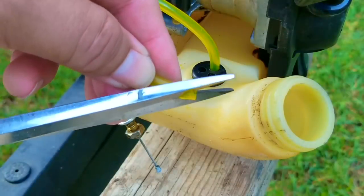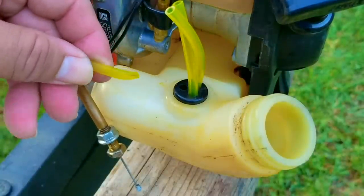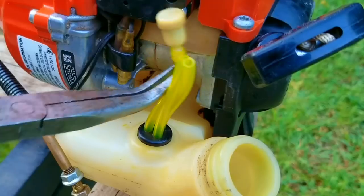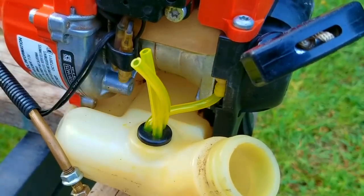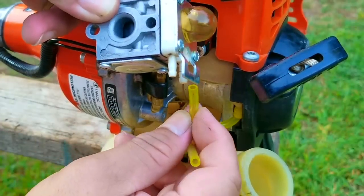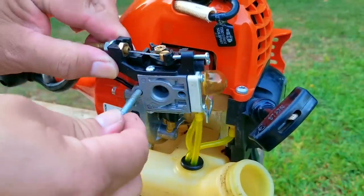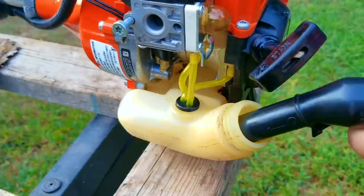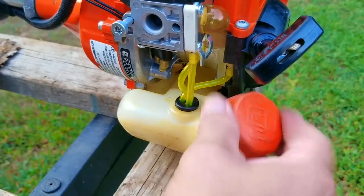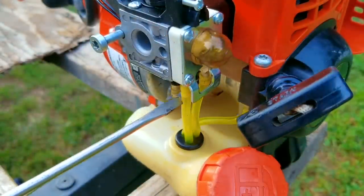For the other two fuel lines, I'm going to leave about one inch of line inside the tank. If you want to make the return line a little bit longer, that's perfectly fine, but it's important to keep the air vent line inside the tank shorter. Once the air vent is cut to length, install it first and put it where it belongs — an opening on the side of the recoil — because it'll give you the most room before the carb is installed. When connecting the fuel lines, the fuel filter line connects to the larger barbed fitting, while the return line connects to the thinner barb. It's important not to mix these up — if you do, the carb will draw fuel from the unfiltered return line and eventually clog the screen inside the carb, stopping fuel flow. Before finishing the carb installation, I want to put some fresh mixed fuel into the tank to test fuel flow through the lines. When pressing the bulb, fuel should come up from the tank through the filter line and into the carb, then partially fill the bulb before going back to the tank through the return line.